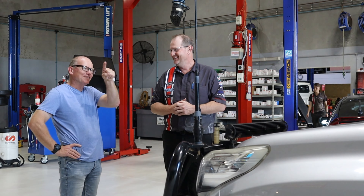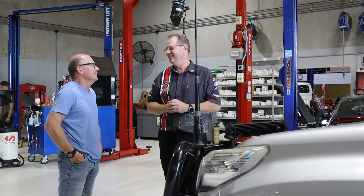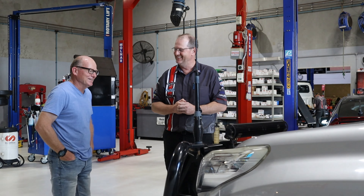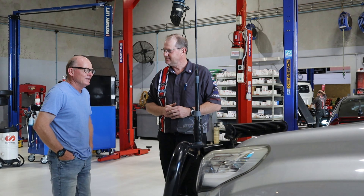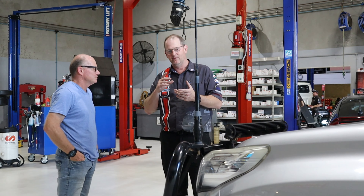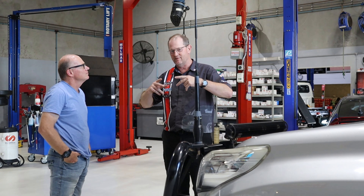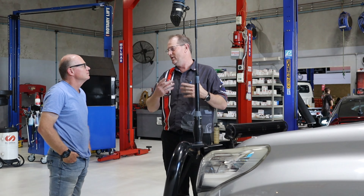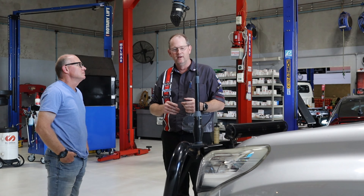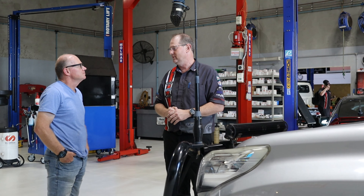We'll get a nice smooth curve on it hopefully, and it all depends on where it starts, but it will go from there. I've got the EGR cleaned up and I wanted to work in with that and keep it clean. Once we start talking EGRs and mechanicals, they dirty manifolds and things get sticky - there's an intake runner that can stick up, and the vanes in the turbo can all suffer from dirty manifolds and EGRs. We'll address all that and just make it run cleaner and smoother.